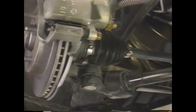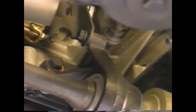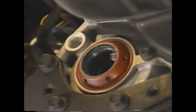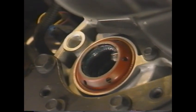Removing the right drive axle seal is similar to the left through ball joint removal. After that, the procedure alters because of the intermediate shaft. To separate the drive axle and intermediate shaft from the transaxle, first remove the intake manifold support bracket. Then remove the cranking motor support bracket. Next, remove the intermediate drive shaft support. Then remove the drive axle and intermediate shaft from the transaxle. Removing the drive axle seal is the same as for the left side, as is the installation procedure.